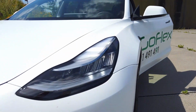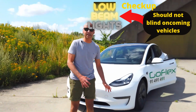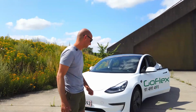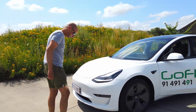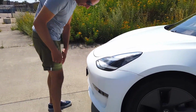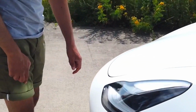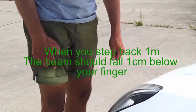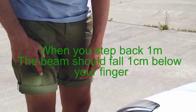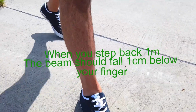We need to do a little checkup. If you have seen my other videos with the black Audi, we will do the same checkup now. Perhaps you've seen it already, then you could skip, but let's have a little look. You stand in front of the light while they're on. You place your finger where the light surface goes to. Take one big step back, because they have to fall with 1 centimeter for each meter you move away from the light. Point a finger where the light goes to, then you take a big step back, 1 meter.